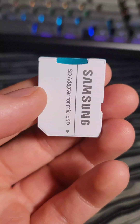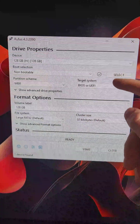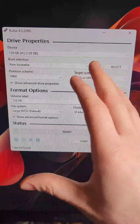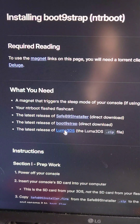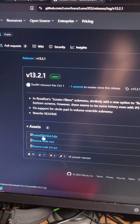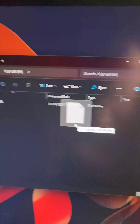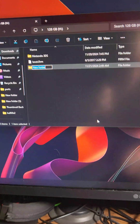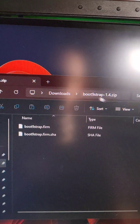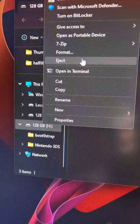Put the microSD card back in the flashcard and flip the switch up to put it into 3DS mode. Then take the 3DS's SD card out and put it in the computer. If you're setting up a brand new SD card, format it the same way as before, but if you're using an old one, don't run Rufus on it. From 3dshacks.guide, download the three files listed. From the last link, grab the Luma zip. Take safeb9sinstaller.firm and put it on the root of the SD card, then rename it to boot.firm. Create a new folder called boot9strap, then from inside the boot9strap zip, grab the two files and drag and drop them into the boot9strap folder. Eject the SD card and put it back in the 3DS.